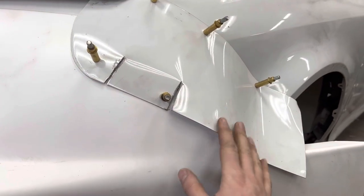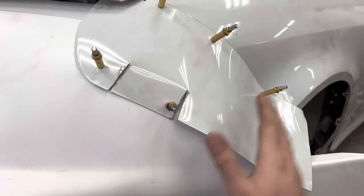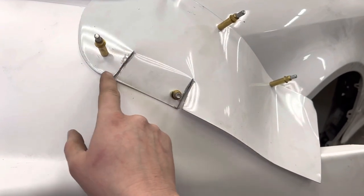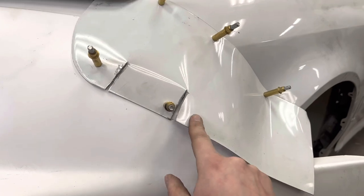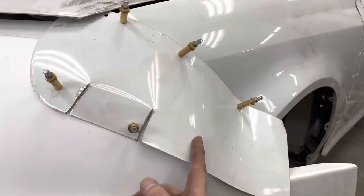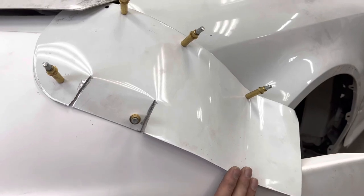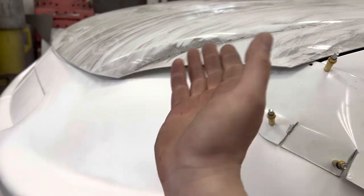And as I go along here and pull this all in, I'll shape it with my hand a little bit, kind of beat on it, and I'll shape it so that the fender flows a little bit better into this nose. But it's going to be rough like this. I'll take this off and I'll clean up the edges and round these off so it doesn't get caught on anything or cut any kids that are playing around your car. But we'll clean it up. This is just a rough version, but I'll probably put one more cut down here someplace. Usually I have 3 cuts on my car, but we'll get this folded down and everything riveted in after I get that bumper bracket welded, bumper mounts and everything welded in.